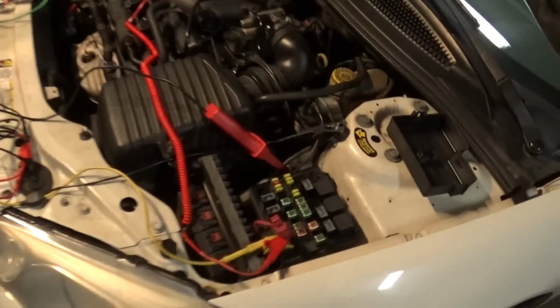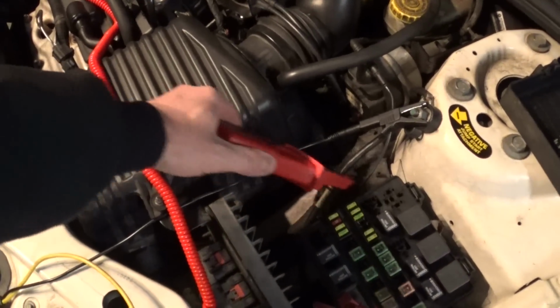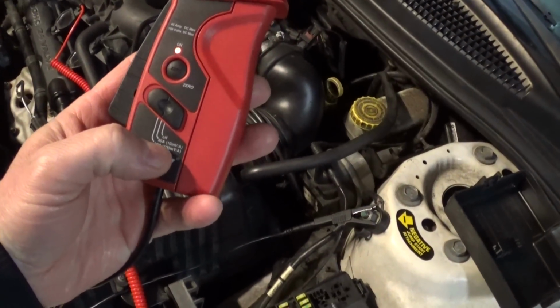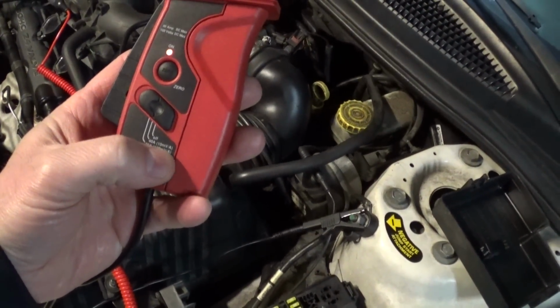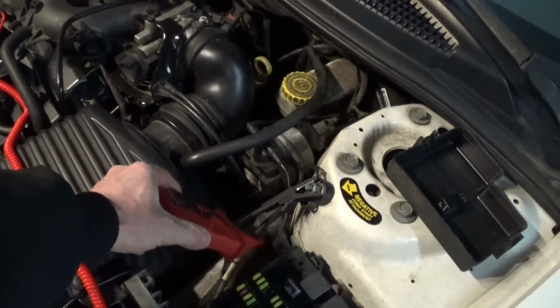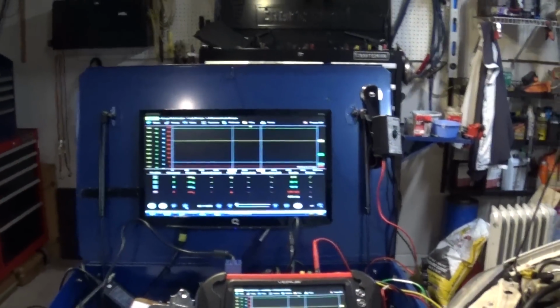You can see, guys, here's my clamp. I'm gonna turn it on, on a 40 amp. Basically 10 millivolts equal 1 amp. Okay, so I'm gonna put it over my battery, and now we're going to change the setting on our channel.